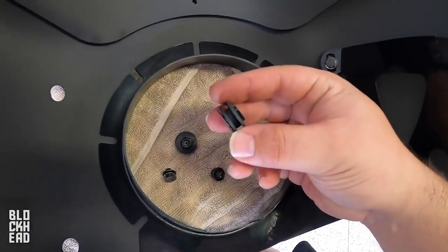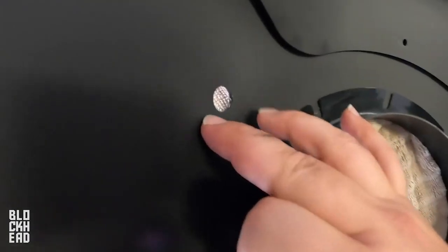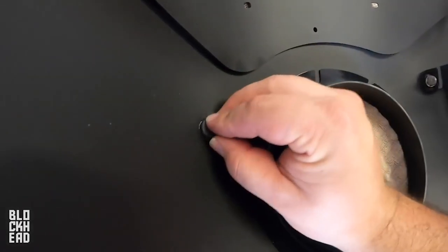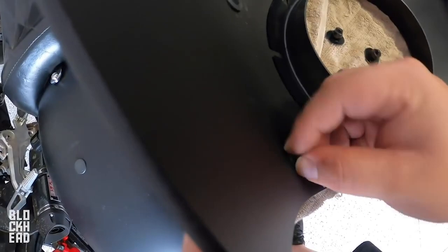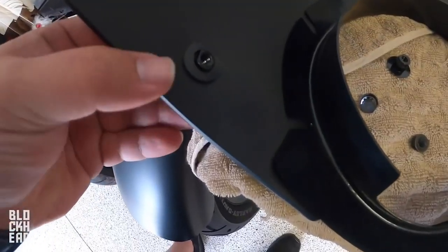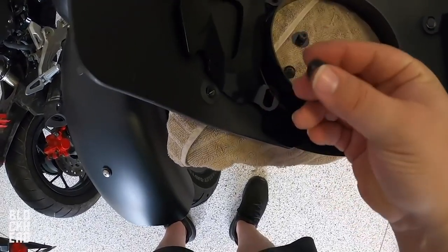After you have them apart, take the little rubber grommet off and put it in the hole — basically like I've done over here. Just work the rubber grommet through there. Same with the other one. Then run this piece through the outside into the fairing, take the bracket, put it there, and tighten it down with the hardware.